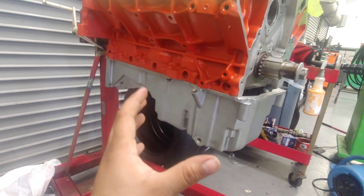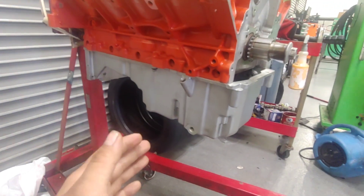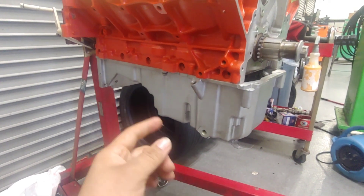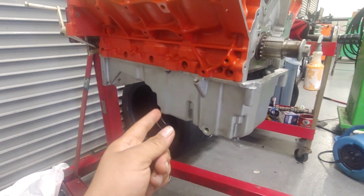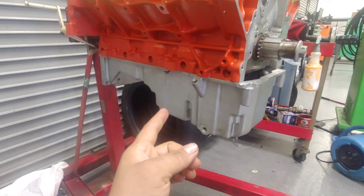Even in this situation, I have to notch out the pan or cut the subframe a little bit. I think I'm leaning towards modifying the subframe that way, so I won't take away the capacity that the oil pan actually holds. I'd rather modify the subframe, or the crossmember.